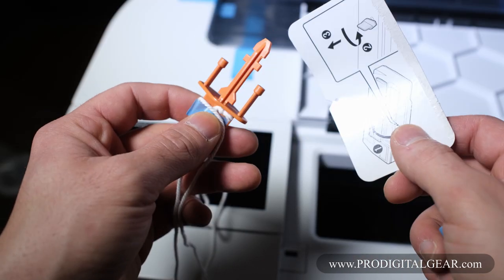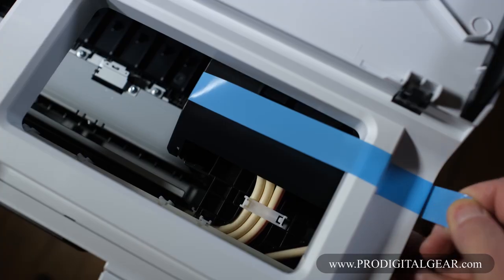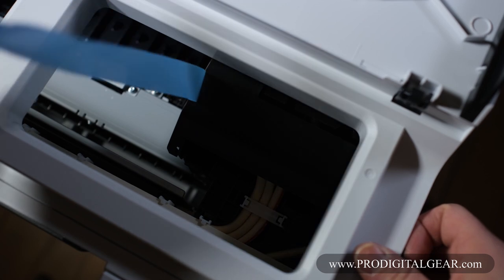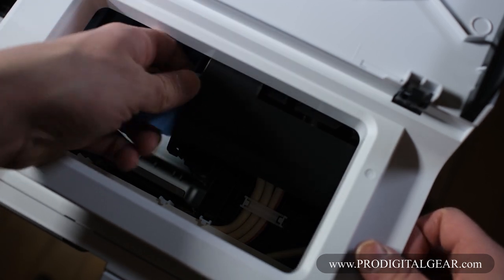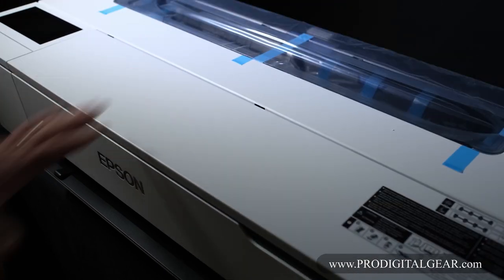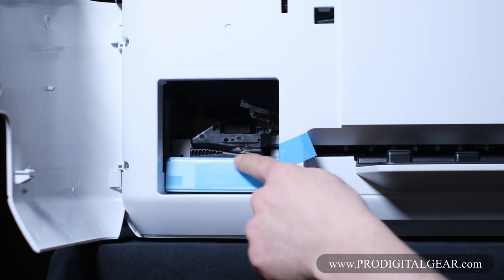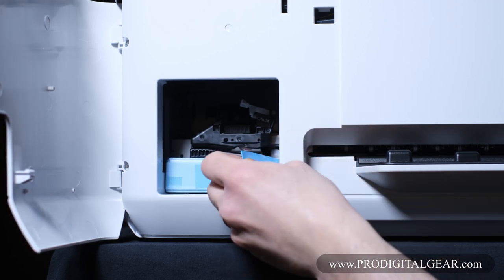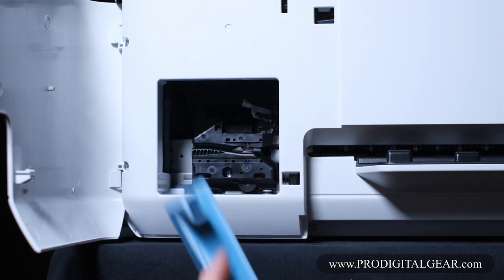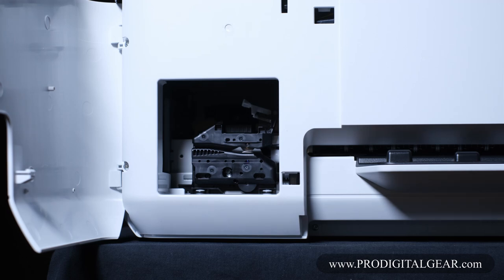You're definitely going to want to save this key in case you decide to ship or move your printer to a new location. Next, we're going to want to carefully remove the blue tape that's over the printhead. Close the cover, and then open this door here on the left side of the printer. There's some foam protection around the cutting blade with some tape on it, so we want to make sure that we remove that. Then go ahead and close the door.